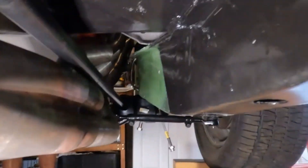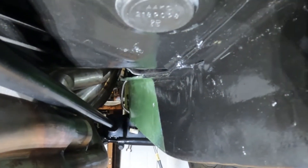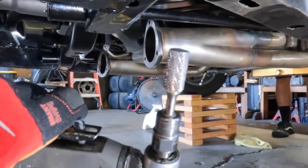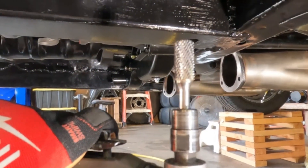So I am slotting this more to make life easier bending that stainless line — that 3/8 line is quite a bit of effort. I'm basically making this thing come back a little bit further, just to make that jog a little easier. I don't want to bend or kink that line. Once we get it through here, it goes right through there. Got my trusty 90-degree die grinder with the carbide bit — these things are magical, though they are tough to use at times. The fuel line continues up and picks up the mechanical fuel pump.